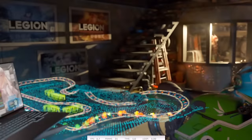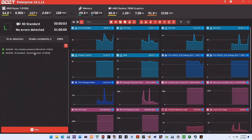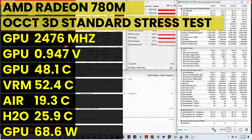For stress testing I include two workloads: the 3DMark Speedway stress test as a proxy for a gaming workload, and the OCCT 3D standard workload as a worst-case scenario. At stock settings, when running the 3DMark Speedway stability test, the average GPU effective clock is 2881MHz at 1.085V, GPU memory clock is 2400MHz, and average GPU ASIC power is 50W. Under the OCCT 3D standard stress test, the average GPU effective clock drops to 2476MHz at 0.947V, GPU memory clock is 2400MHz, and average GPU ASIC power is 69W.